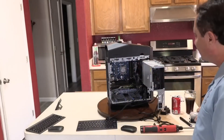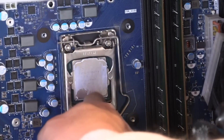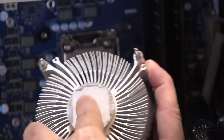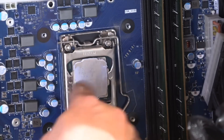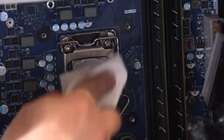If you look closely at the CPU, you can see there's a big empty space along here — no thermal compound — which probably aligns with a gap on the heat sink. It's not a very good coverage on the CPU, and what is there is applied so lightly you can almost see right through it. I want to wipe all that off and get all the existing thermal compound removed. To do that, first I'll grab a paper towel and just wipe it.